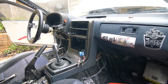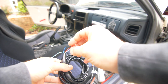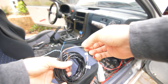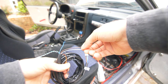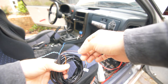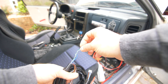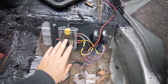Here's the harness for the electrical connections — this side connects to the gauge itself. Red is the 12-volt, 5-amp fuse-protected switched power source. Black is the ground for the gauge. Then you have brown and white — these are the analog outputs, so you'll want to connect these to your ECU. If your ECU doesn't support a differential analog output, connect white as the input and brown to your signal ground or ECU ground. Blue is the serial output — we're not going to use this. Green and white are the AEM net outputs — also not going to use these. For power, I already have a switch panel built, so I'll just add another fuse for the wideband.